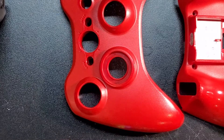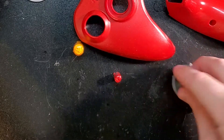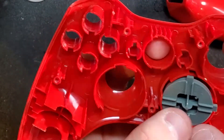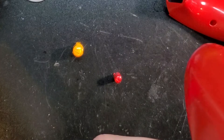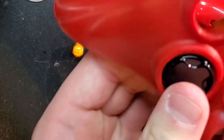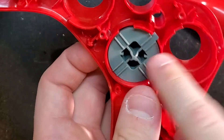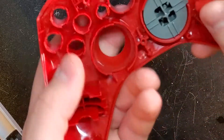All the parts have been washed and are kind of dried. Triggers are back on — a little bit of a pain in the ass, so I had to cut. We're going to put the D-pad back in place: this piece goes in here and then this clips back in. I didn't show this on the teardown because I was originally going to wash it as one piece, but I noticed it was really, really bad. That goes back together, and there are two screws down here that I'm going to put in now. So that's back in. Next, we're going to need our buttons. First try — alright!